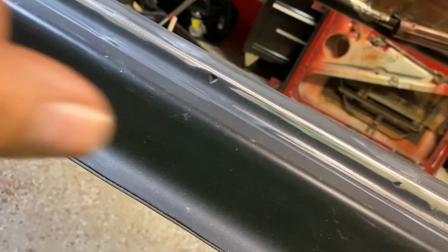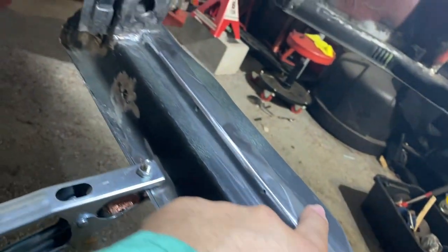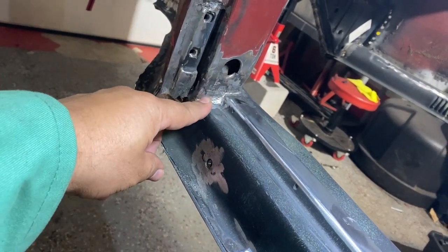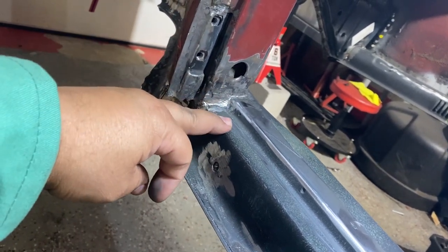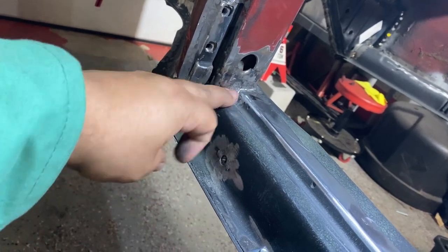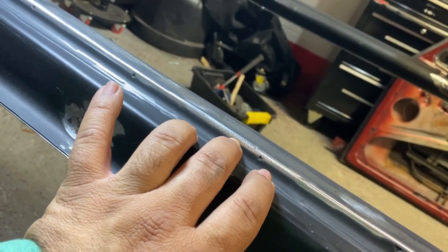As you can see, I added the plug weld and everything, grind it down smooth, did it along the whole way to the end. Just a side note: when you guys weld this area here, be sure you clean it up really well if you're going to make this look nice. The carpet doesn't cover this area — usually you paint it, and this is kind of the first thing people see when they open the door. So if you want this looking nice, definitely address this area. I'm prepped here — grind this back so I can add that carpet gripper. And then I'm going to clean the carpet gripper and get it ready for install.